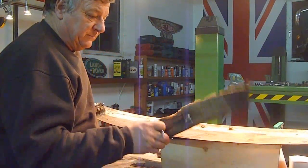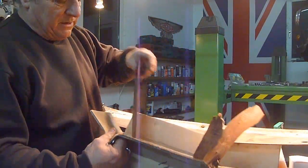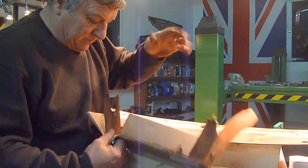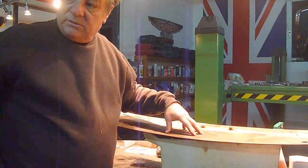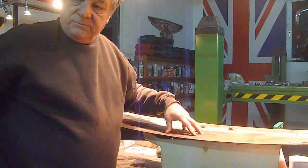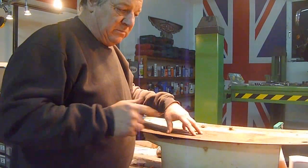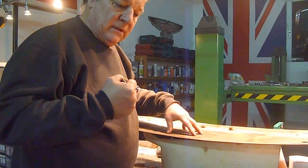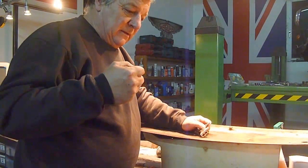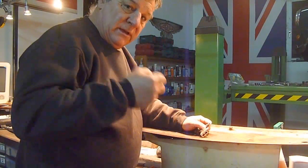As you can see, it's a lot of work. From all these bits here it just delaminated — completely fell apart. This thing is reasonably thick but it just splintered. This is something you'll find with anything that's wood. The tack rail that goes on the back of the E-Type is made of wood and they were terrible for rotting — you can imagine the water seeping into them. Now they've got a composite one which is plastic and nylon, but it's easy to put air staples into it — you couldn't do it with a staple gun, but an air staple will go into it.